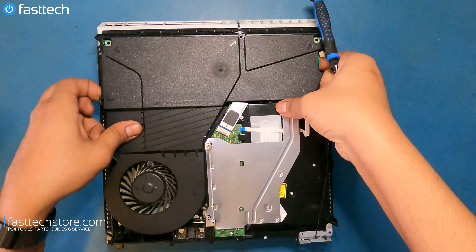We're going to disconnect this power cable that's on the side — grab it by the connector and pull — and then we're going to lift the power supply out. As you can see, the antenna connection runs here. We're going to disconnect it by lifting it out like that. There's a Torx T8H screw that's holding the antenna down, and that one does not look like it was damaged, so we're just going to take that one out with our normal bit.